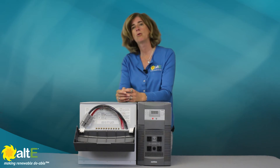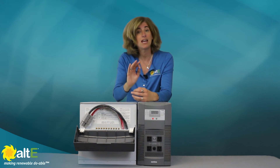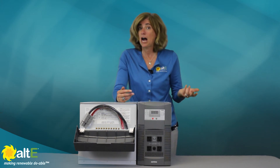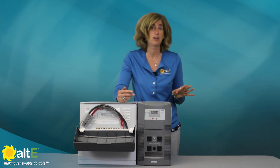For examples of how long the battery power will last: you can power a typical fridge for half a day with two batteries, or a whole day with four batteries. However, things that use less power, like a laptop, can be powered all day with just two batteries, and a cell phone can be powered for a week with one battery. So you need to determine what you would need to power during an emergency and for how long. Then you can figure out how many batteries you'd need. You can go to our website to the Critical Loads Calculator, and that can be a great start to figure that all out.